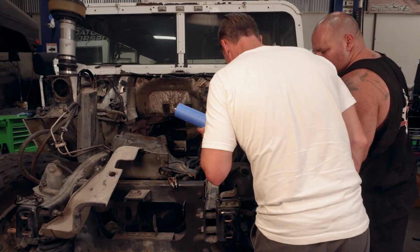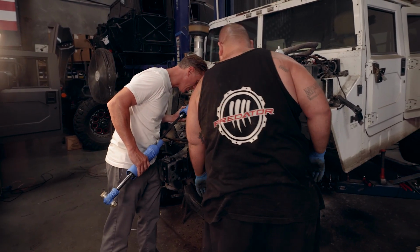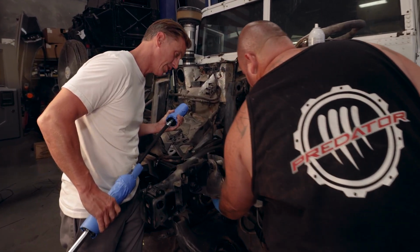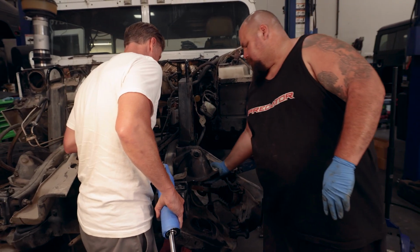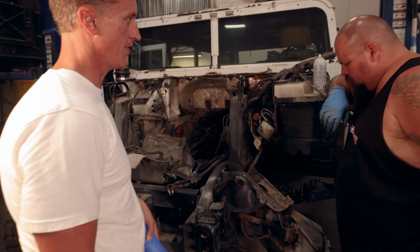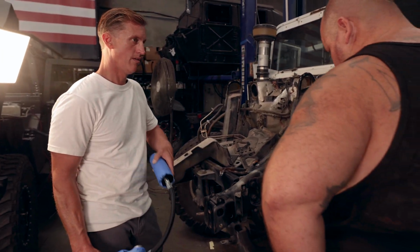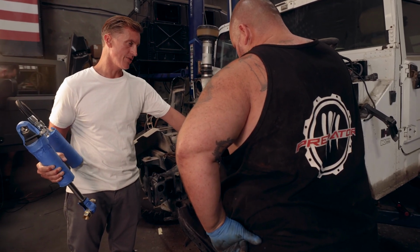I don't think it's gonna go through, do you? Yeah, I guess let's just pop it off, but you can't, you're right, dude. You can't get in there. You'd have to cut that, huh? You would have to go through here. Unless you cut that section out. That's the section where the spring sits in. You could hole saw that piece out and then have like a CNC'd cap that goes on there that fully welds it in and boxes it in place.